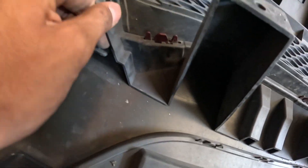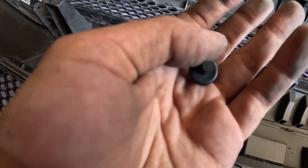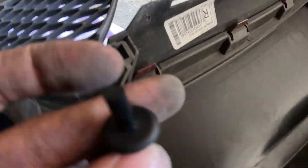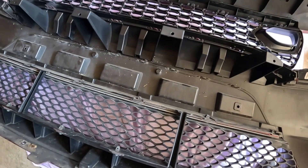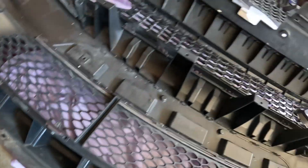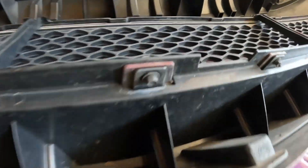Then we ran into this — we were wondering why it wasn't coming out. There are these weird little plastic push pins I've never seen before — they have a real pin in the middle and from the other side you have to punch it out. Here's one right here — you can see it's flush and not sticking out so you have to punch that out. The snorkel grill is in up top. The bottom grill has a bunch of bolts in it, and on the front side of the bumper underneath has bolts also, and it also has tabs.